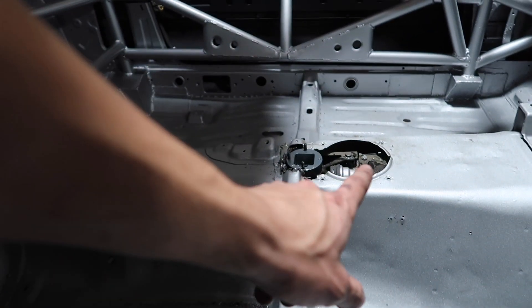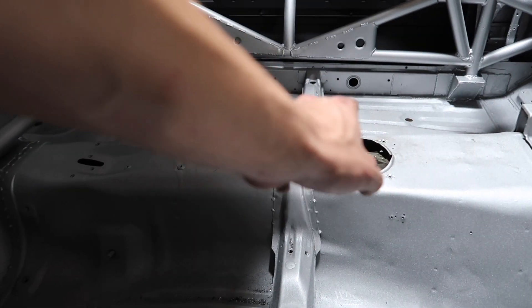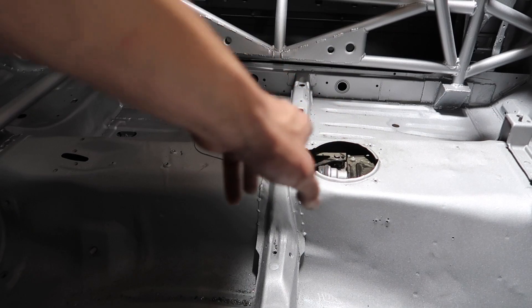Hopefully nothing ever happens to this thing, because taking it out is not fun. I do expect some parts to hit — it is a massive transmission, massive bell housing, just a super long drivetrain. We clearanced for probably three or four hours trying to get this thing to fit, and we finally got it in. Shifter's in. Before I show you guys this shifter hole, don't even say anything — I don't have a grinder. I'm going to clean this up and make it really good. I have great plans for it, but this is where the shifter sits — about two inches back from where the factory one sits.